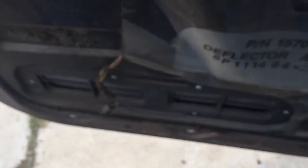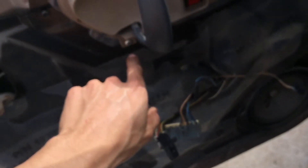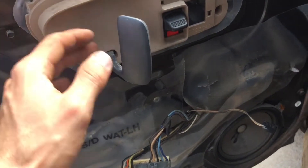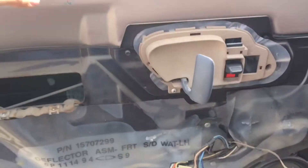What I'm gonna do is lift the window up — once I do that I have access through these two holes. The pros of being skinny is I can fit my whole arm through there. I'll drill out or take this rivet off, roll up the window, and take it off. To put it back is basically the reverse: push the panel back on, seat those tabs and pins from the door.